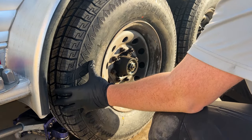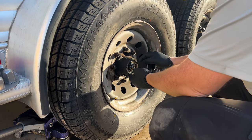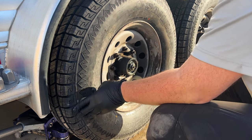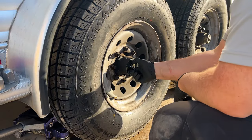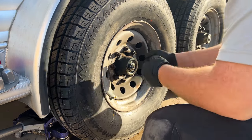What's really actually pretty cool about trailers is that once this is just a serviceable item, you'll actually just turn this nut here and you'll hand snug it. And just by hand snugging it, you have no play. So once you have no play and you're hand tight, that's actually where these like to be, is at this zero lash type of place where there's no play.